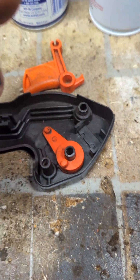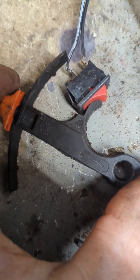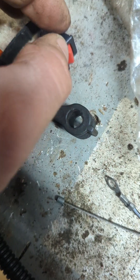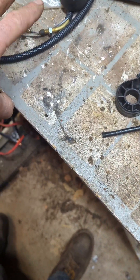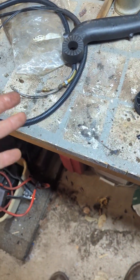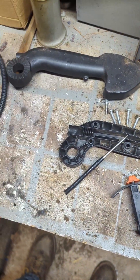The part that's worn out — right here at the tip of my thumb — that's the part that rocks on the switch. When you throw it forward all the way to shut it off, it doesn't click all the way. I don't usually rebuild these because that piece is worn out. It's not really worth it to buy just the cable. You can buy a whole assembly pretty much anywhere for between $38 to $45 delivered, or you can buy just the cable setup for around $25 if you're in a jam. It'll work, but I don't usually recommend it.